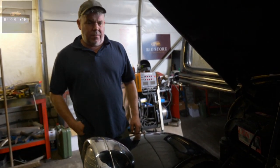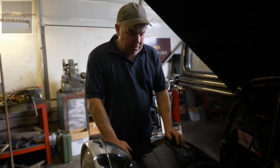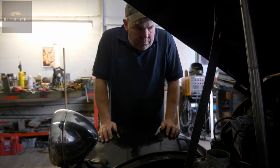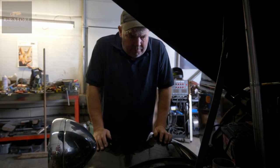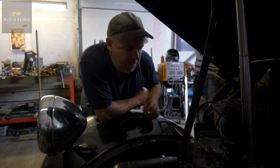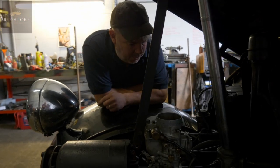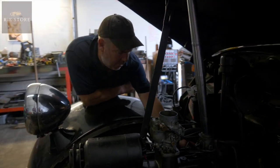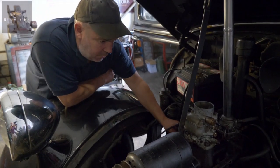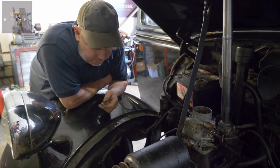They made about 22,000 I think. Not a lot really by car standards. It was old-fashioned when it came out — 1946 or 1947. Luckily this one's been converted to 12 volt. Originally it would have been a Stromberg carb but the British put a Solex on it — slightly different casting. There are core plugs in the back of the block behind the cylinder head, and bits and pieces that are different, but nothing majorly different. Different big end shells basically.